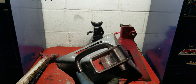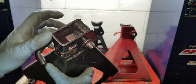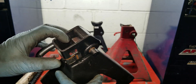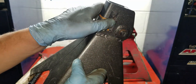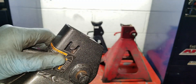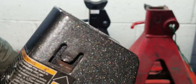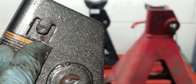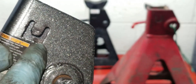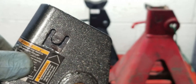What I'm thinking is possibly the actual pawl — I guess you would call it the parking pawl — it's just a cast iron piece that actually might be severing and snapping off due to the teeth depth, meaning it doesn't travel too far down that pawl's length. If you can kind of see a cross-section of it, you can see it peeking through there. It's not very wide — it's kind of a very thin point. So I'm sure what's going on is that is actually snapping off. It only goes in a certain amount, so if the teeth depth were longer, they would engage a meatier spot of this parking pawl. It basically curves down like that and up around like that — I think it's just snapping off the end right there. That's my guess.